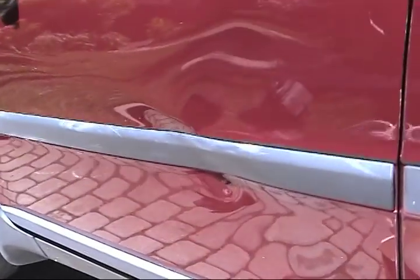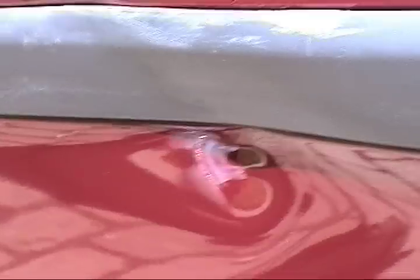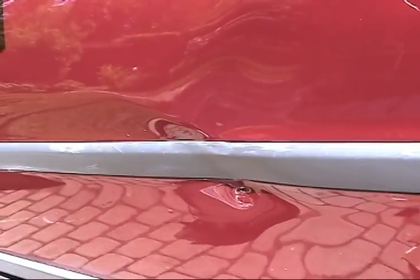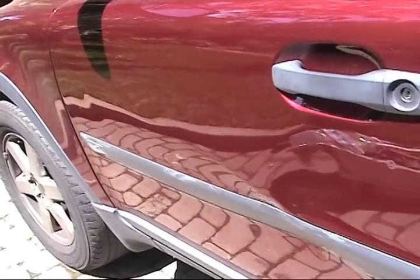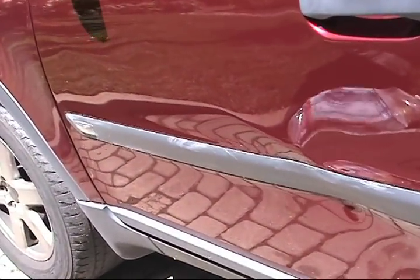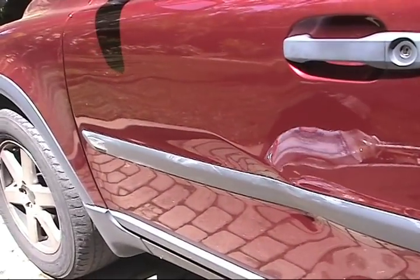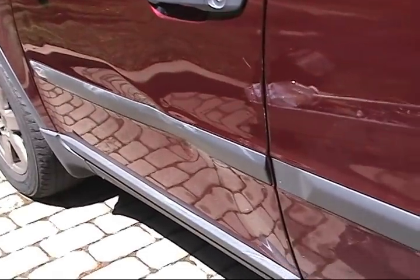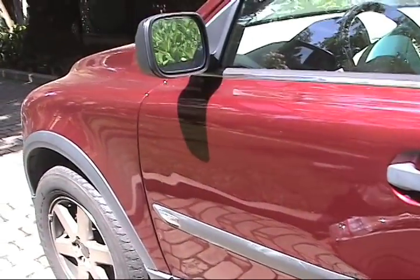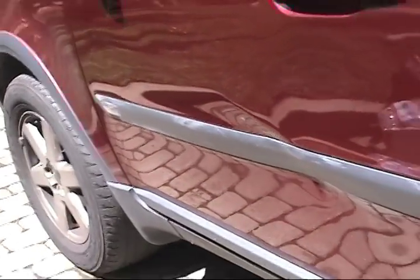Volvo got backed into. Looks like maybe a trailer hitch. What's unique about Volvo XC90s is the beam right there. It's one of the hardest beams that I've ever worked on, next to a 3 Series BMW 2-door beam. This one runs diagonal from the bottom of the door all the way to the top. Whenever one of those gets hit, it creates some real challenges.